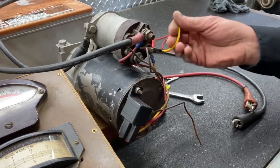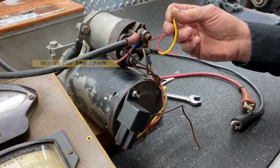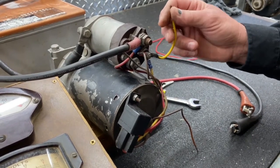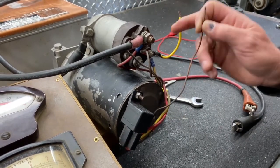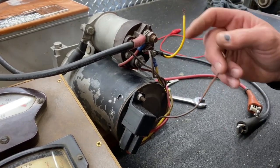Here's the old key wire that would not have had a relay — there's a pretty good spark there. And now here's the relay that's installed, which carries the load instead of the key switch — you can hardly see any arc at all.